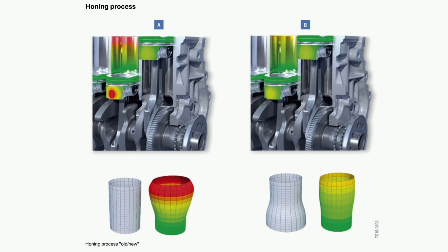Another thing BMW did is optimize the cylinder honing process. They basically compensated for all the extra heat you're going to experience at the top of the cylinder, which is where the combustion process is happening and where most of the heat is. They make the bottom slightly wider, and once the engine gets up to temperature and starts experiencing higher temperatures, everything deflects and creates a much more square form factor. This helps keep things more reliable, reduces deflection, and helps avoid friction issues in your highest load scenarios where you're creating a lot of heat.